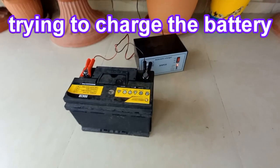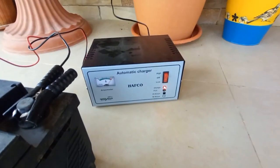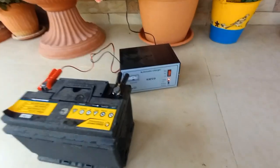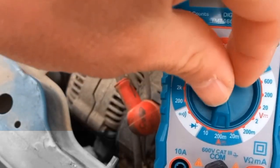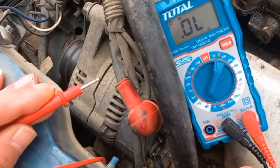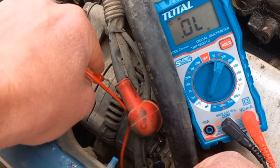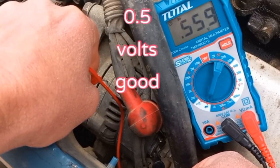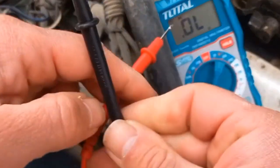In this time, I will check the alternator diode first to see if it's draining the battery. To check the alternator diode, the battery should be disconnected. The alternator diode should pass current only one way — from the alternator to the battery, but not the opposite way. Multimeter on diode mode. Connecting the multimeter leads — one to the B plus post on the alternator, and the other on the alternator case, then swap the leads. One way you should get a reading from 0.2 to 1.3 volts for most vehicles, and the other way you should get a very high resistance or OL.